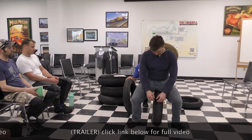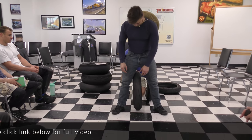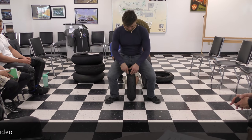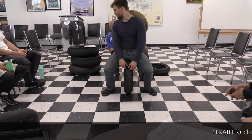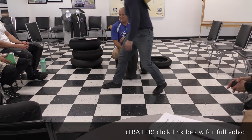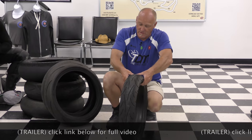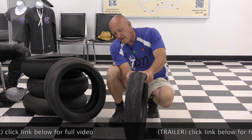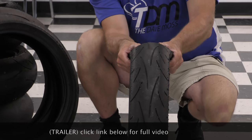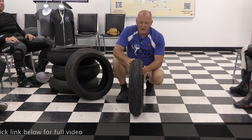See what's happening underneath — the inversion of the tire. Okay, stand up, swap out those two. Which was the softer tire? Sit on that. You get to judge. Okay, this is a race slick — that's interesting. Why is this carcass softer than this? Why is it doing this? And when you do that, look at the sidewall — see how it bellies? It gets back. So if you don't have the right amount of pressure, you're never going to get the right contact patch.